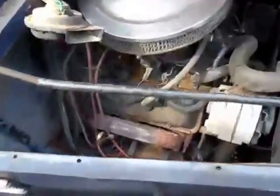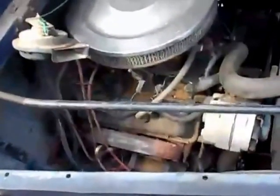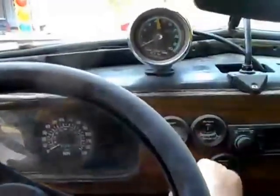It's got good clean oil in the V6. It's a mystery V6. I'm not sure what it is. It's a small GM V6, maybe a Buick or Oldsmobile, not sure. It's got a custom sheet metal firewall that's been built in there. This other side, it's got power disc brakes, power steering. It's got a booster there. Little carburetor. It's got a little cooling fan on the front side of the radiator. Again, not really sure what engine, but it doesn't smoke and it doesn't make any strange noises. Seems to run really well, actually.